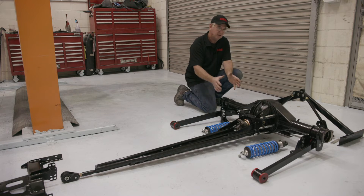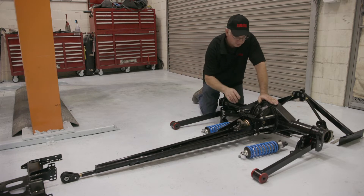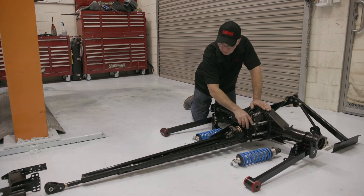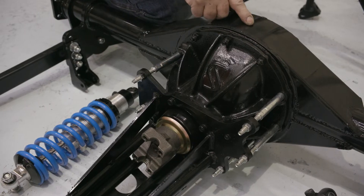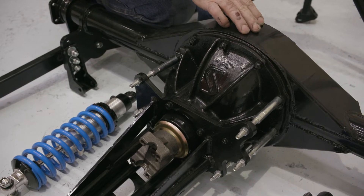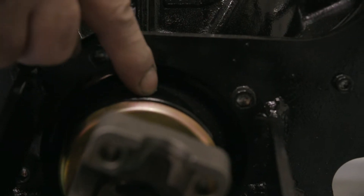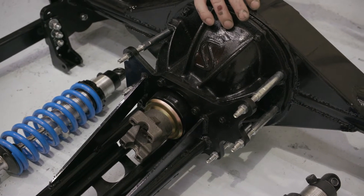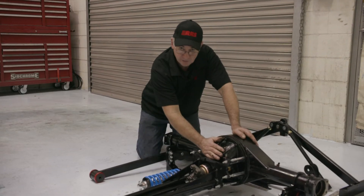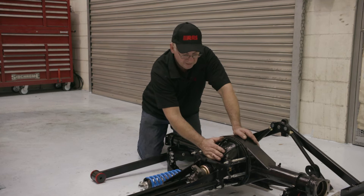This had to have custom brakes and custom axles that are exceptionally short. Other things that we've already set up and mounted — and you'll see this when it goes in the car — is we've mounted the hard lines in a different way than you would find in a standard vehicle for the brake lines. So we have a strange axle housing which is reinforced and baffled, a strange centre section, which makes it bulletproof. Daytona pinion snout and a 1350 yoke, so we take the big size unit. It's also fitted with super strong Mark Williams axles. This is fitted with a TrueTrack centre and 3.5 rear gears because it has a five-speed overdrive manual transmission.